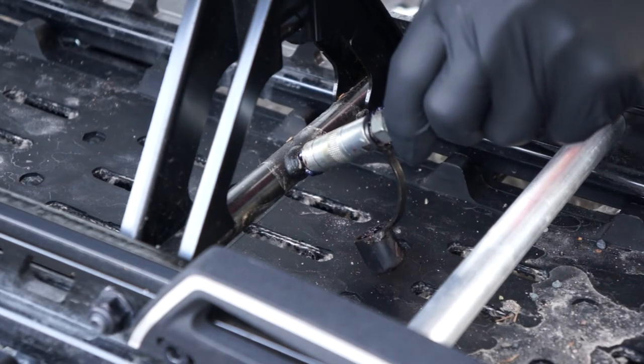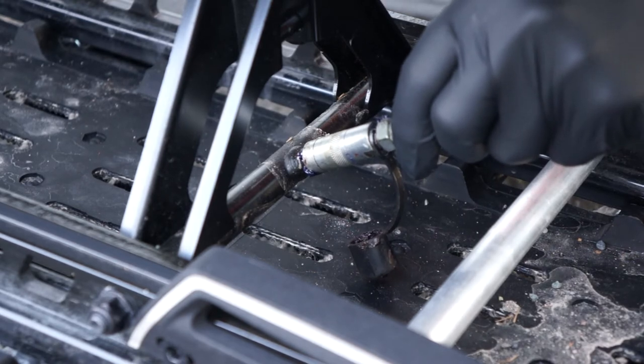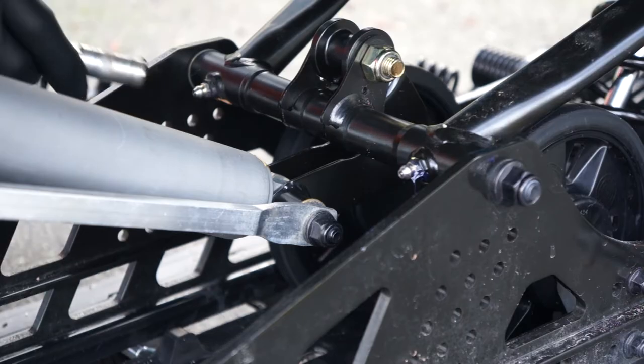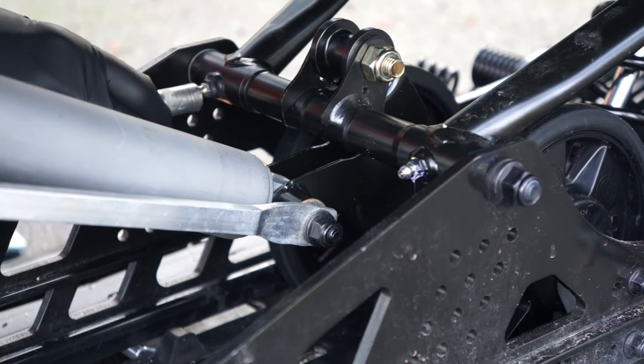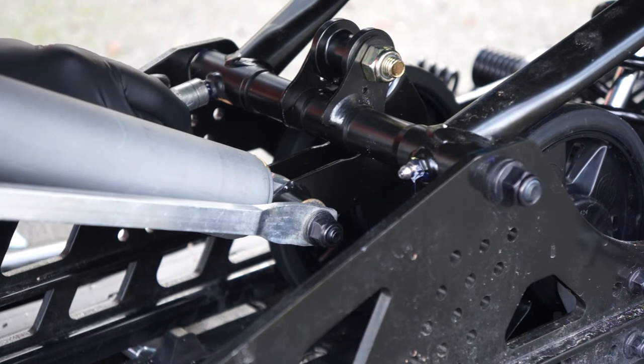You're just going to hook up your grease gun and add some grease. You roughly need between two and three pumps. You don't want to blast a whole bunch of grease in there, as that could push out any of the bushings, so it's really important that you just put a little bit in there. If you see a tiny bit coming out of the ends, that's more than enough.